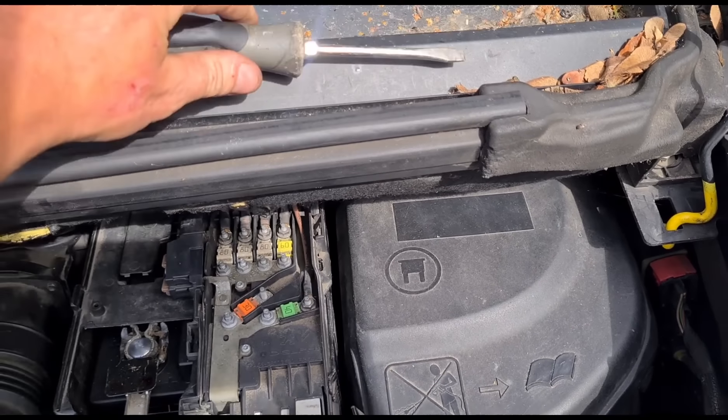That fault is now cleared and we've got one left in the radio — we're not too concerned about that. Coming outside, we're going to confirm we've got at least 14 volts on the charging system, so the battery is charging. Like I said, the battery was replaced three times. They were nice enough to let her keep the old ones, so she's got three extra batteries in the house plus the one fitted. They couldn't return them as used batteries, which was kind of nice — but it would have been better if they could have just fixed the car. So that's it, we're all finished. I've taken it around the block and I'll see you on the next video.